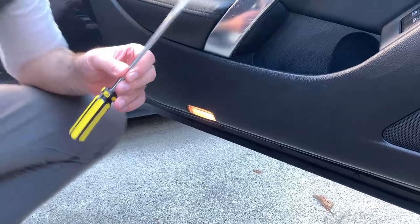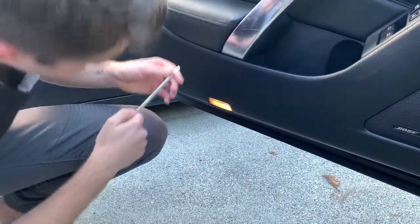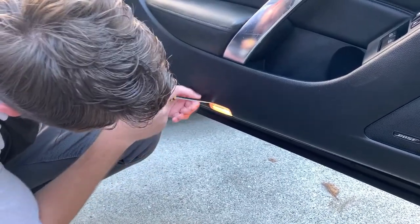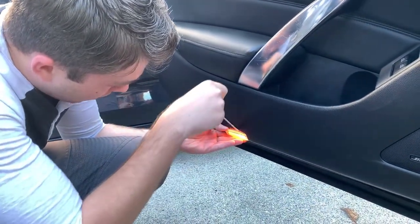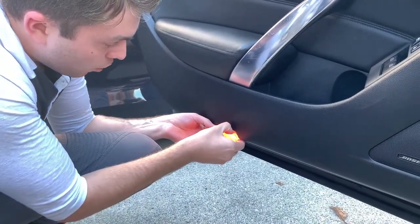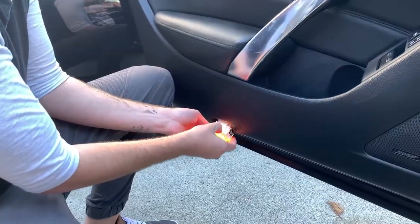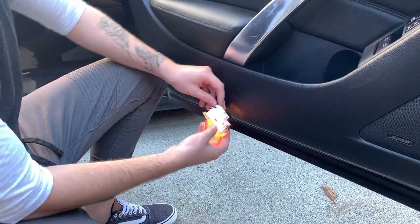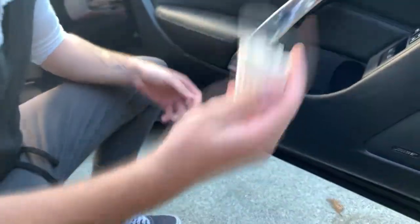What you're going to do is take a flat head screwdriver very gently, very carefully wedge it under the light. Make sure not to ruin your door trim — keep in mind that it is metal. Very gently, just like how I did it, and then slowly tug on it like that. You can see the light is out. At this point, we're going to unplug the light, push the tab, unplug it. This is your factory light.